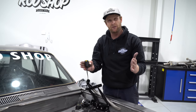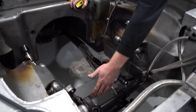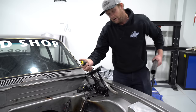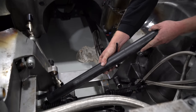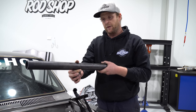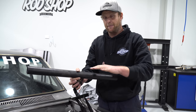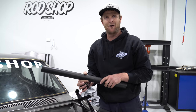Once we cut that out, the shaft might want to fold in a bit, so I'm going to remove this and probably blow the rack brackets off. Then I'm going to do a bit of a two-for-one deal - replace the rack with a bit of tube up in these scallops under these holes here, get that welded in position. That will hold the rails apart from folding in under pressure, and also locate the rack. Hopefully we get the engine down about 80mm - that's what we're aiming for.